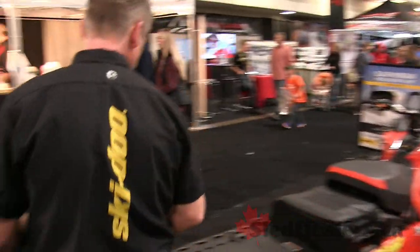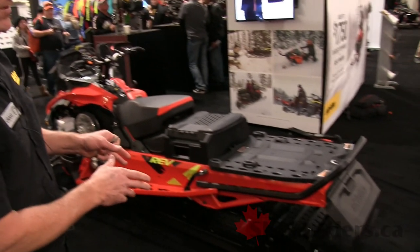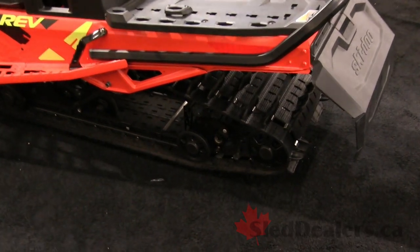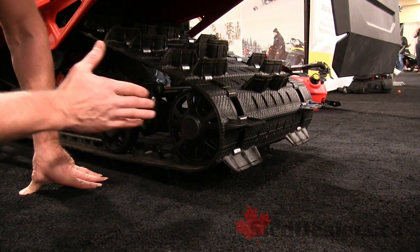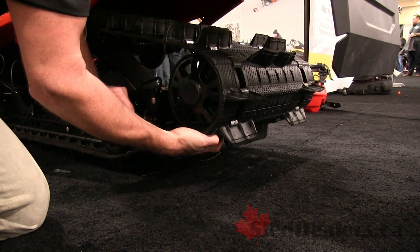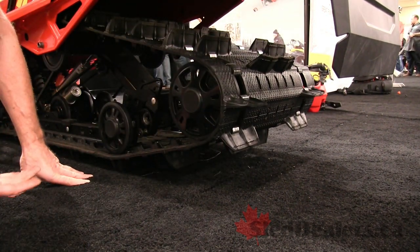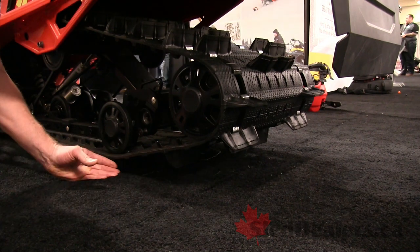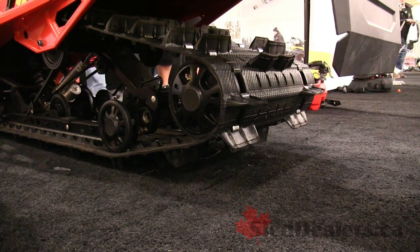One more really important feature: it's got the 154-inch, 20-inch wide track with a 1.8-inch paddle — very aggressive, made for deep snow. The rail comes to here and there's a mechanism that allows the track to climb up when you're backing up in snow so it's not locked down. Basically, you climb up on the snow instead of digging in. You also have the ability to lock that track down, so on tight trails it acts more like a shorter track since you're reducing the contact patch. That really helps with maneuverability and with backing up when it's unlocked.